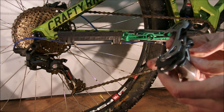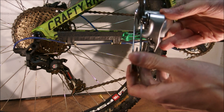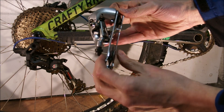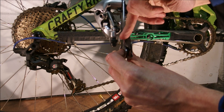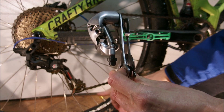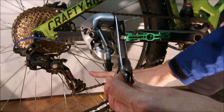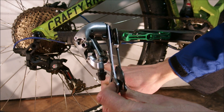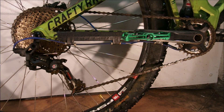This is a typical derailleur and this is its cage, which is completely straight. If I take the lowest pulley and offset it to the outside of the bike, like Shimano does on the XTR, the angle at which the chain approaches the pulley gets lessened — which means that the issues caused by chain line, being noise and wear, are much lessened. This is more important on 12 speed drivetrains because the cassettes on 12 speed drivetrains are even wider.